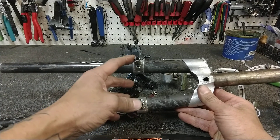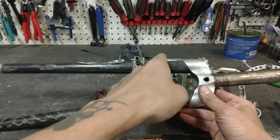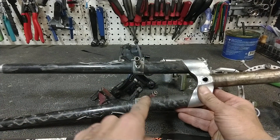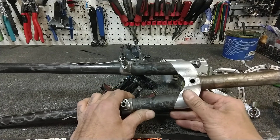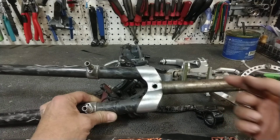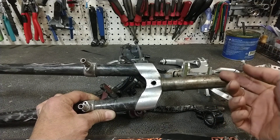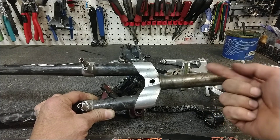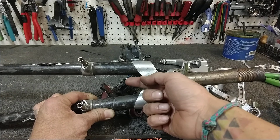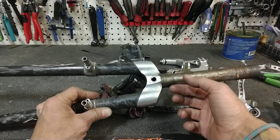What you have is two arms that sit up here. Brake pads come in, and then there's a central cable called the straddle cable, which goes from side to side. You need to have a cable stop somewhere — sometimes it's in the fork, sometimes it's up higher near the stem. Cable comes from your brake levers, usually road levers, sometimes mountain levers, through the housing down to the cable stop. The bare cable goes down and clamps to the straddle cable. It pulls up, the arms swing in, and you get stopping.